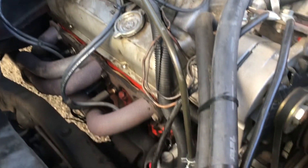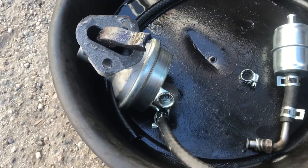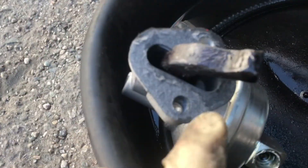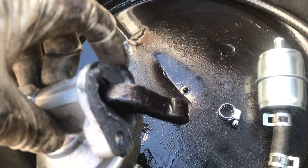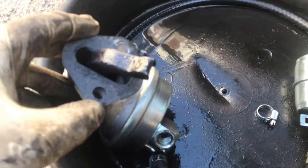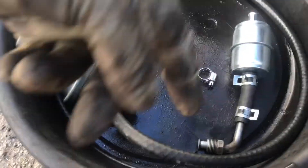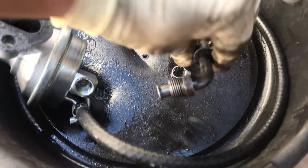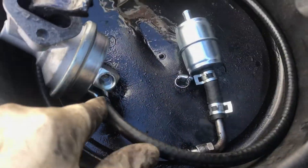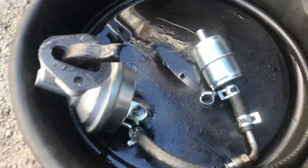Here's a little technical thing — you can see the gasket stayed on. In case you're ever wondering — I just had a little bit of tackiness to stick it to the pump, so the gasket did stay on the block a little bit. And I had some thread tape — just a little bit — and it appears to have stayed. It didn't go into the pump or anything, so that's good to know. And then the bolts — I had thread sealer on them — just a little bit, still on there. Just a schmear, they say.